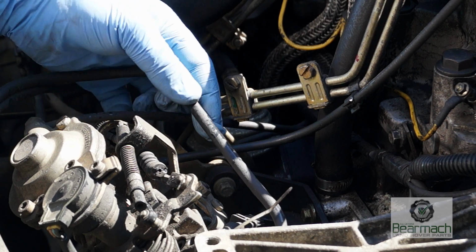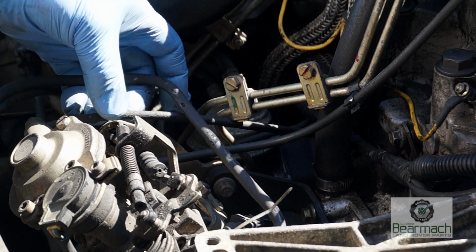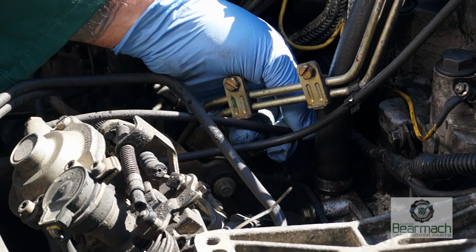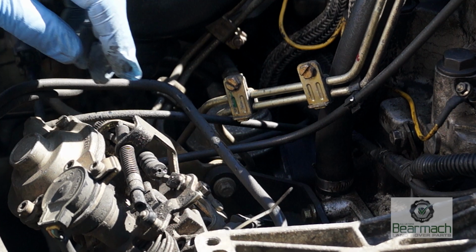Okay, so we have fuel lines here, and chafing on 2 pipes, eventually you'll get a fuel leak and will cause you problems. This piping's loose and it's also touching somewhere else. It's worth checking very carefully for any chafes.